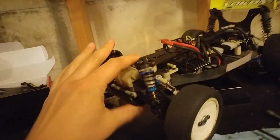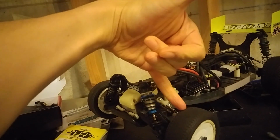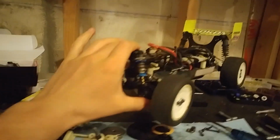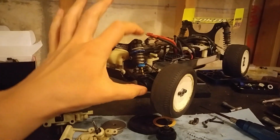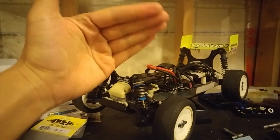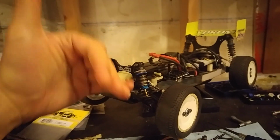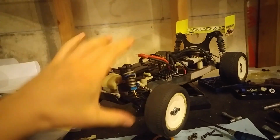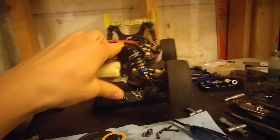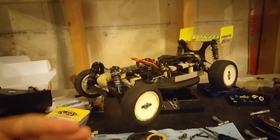Now, the problem with that unit is that because you had these turnbuckles that extended from the torque rod stay to that ball stud that's on the little ear there on the caster block, if those turnbuckles are just a little bit too long or a little bit too short, it would cause bind in the suspension travel. So you would have to set up the turnbuckle length on that torque rod with the shocks off, so you can make sure the suspension is moving freely throughout the entire range. And what you end up finding is that the correct length for that torque rod actually ends up limiting droop. So if you run that torque rod in a way so that you get nice free suspension travel over the entire travel, you're going to have to sacrifice a little bit of front droop. So if you take that torque rod off, you don't have that limitation, and you can end up with a little bit more front droop, which, just like the rear, gives you better jumping and landing performance.